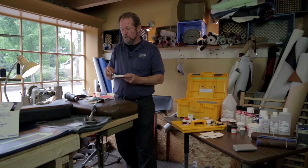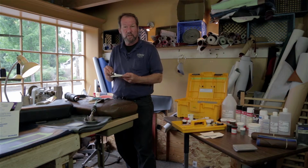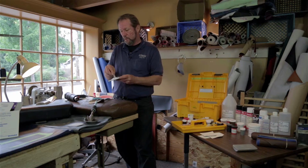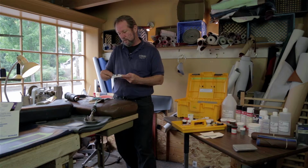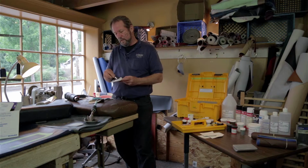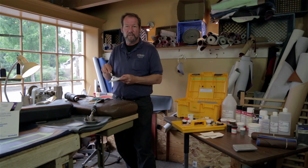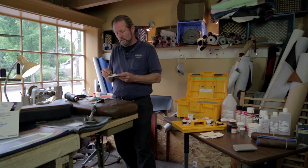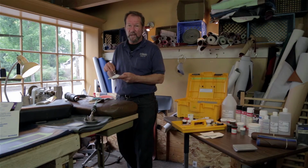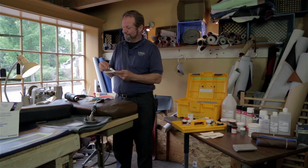This part of the process you only have to do once. You make that rubber mold for the grain and you're going to use it over and over again. It's literally a tool. So a couple of extra minutes at the beginning to do this will give you a tool that will be able to hide those repairs, versus having a smooth, shiny spot on the seat that's going to be picked at, or as I've heard school bus drivers say, it looks like broken eggs on the seat, and the kids just kept picking at it until it came apart. So we don't want that.